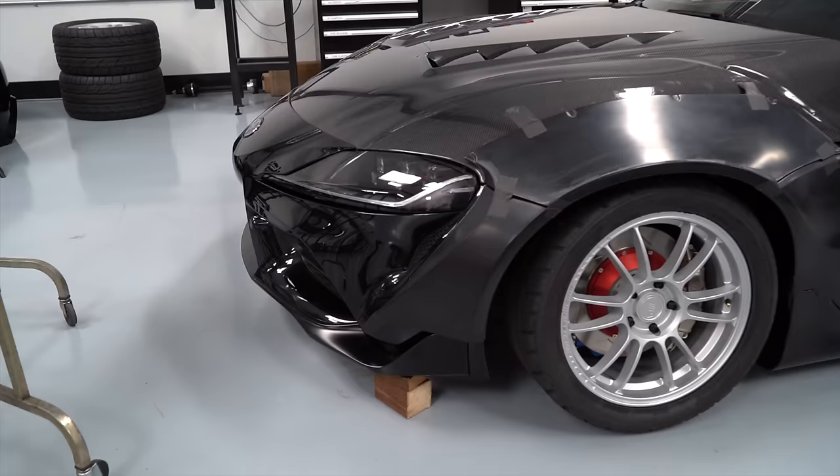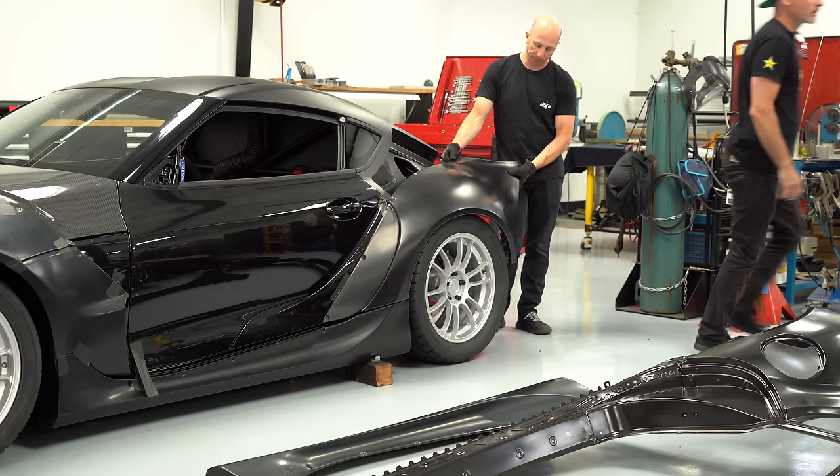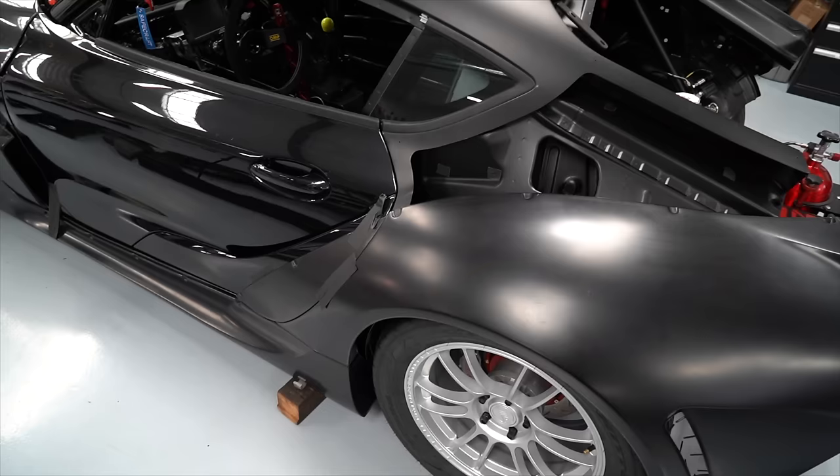Once we were confident that we can make the body kit work, we started trimming the components. The rear of the car we cut up so much that we're going to have to replace the rear quarter panel. The reason we do this is because these cars get hit a lot in the front and also in the rear. In the rear of the car especially, there's a lot of the unibody back there that if it gets hit, it's really hard to fix at the track. So what we do is we basically cut off all of the areas that the rules allow us to cut off.